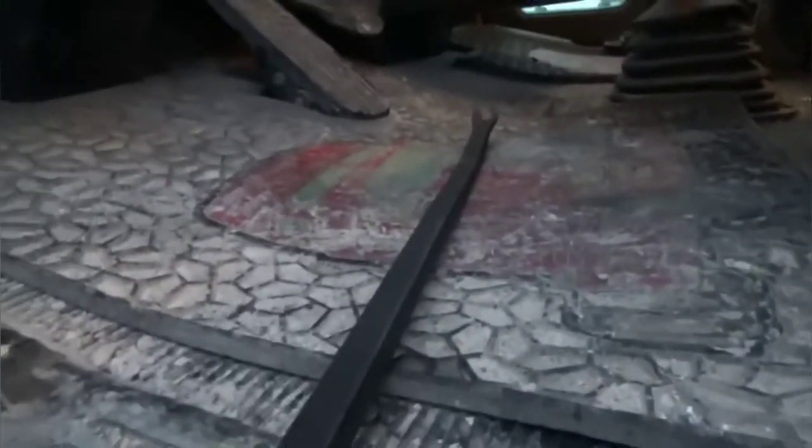Alright, we're back up top again. See what we got here. There's your play. That's not too bad. And that's where the clutch starts to engage right there. So I'd say that's pretty decent right there. So I don't know what I did, probably 8 turns maybe. Probably wasn't complete turns each time, it was about a half a turn each time. So I think we'll deal with that. Anyway, just a quick little quickie on clutch adjustment. Nothing big, spectacular, but I'll go back under there and let y'all see me put stuff back together.